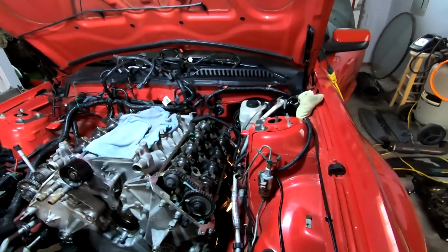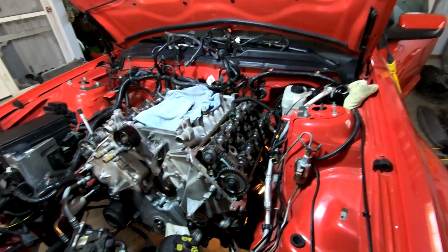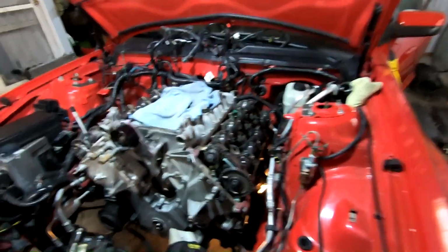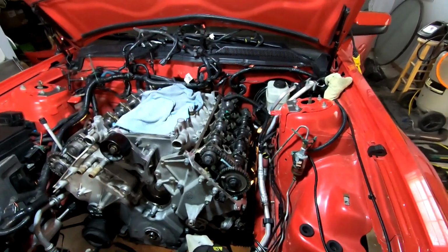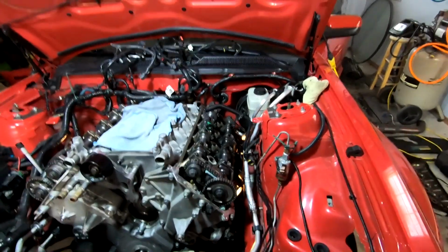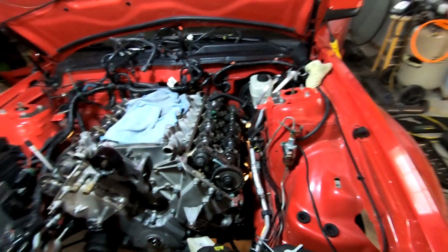Also, I should mention, I'm pretty sure I mentioned this before, but just in case I didn't, motor mount bolts, I don't know the torque spec for those, so I went until fairly tight. They are probably around, say, 40 to 50 foot-pounds is good. And then same thing with the steering shaft. Don't know the foot-poundage for that, but it went until it's pretty tight. And those are aluminum brackets, I'm pretty sure, so don't strip them.